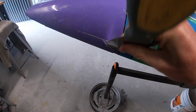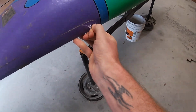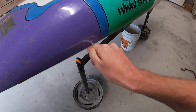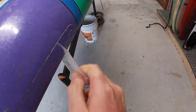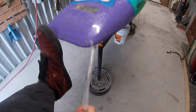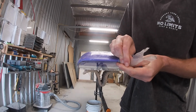Protective stickers aren't going to be too difficult. We'll start it off with the metal blade, just prying it open a bit, and then just using the hands we'll pull them back. These stickers do leave a fair bit of glue behind as well, so we're going to have to get the wax and grease remover and wipe all that clean too before we can start sanding. Doing all this with a camera in hand is pretty difficult, but there's always the foot to help with a bit of leverage. And once you've got them going, they're not that difficult to get off. They peel back pretty easy.